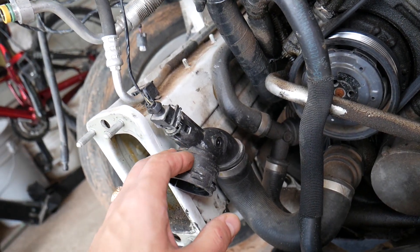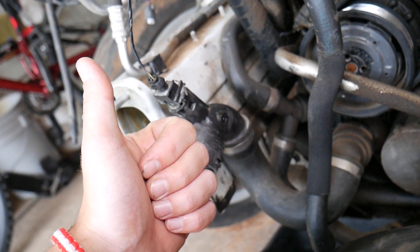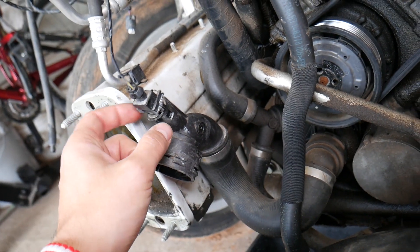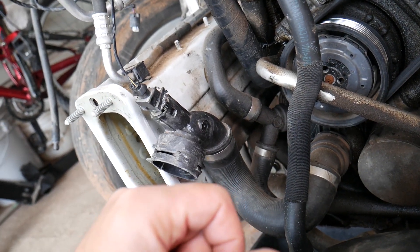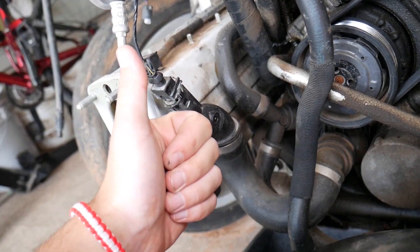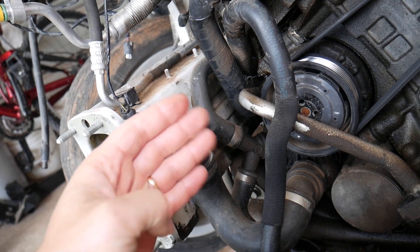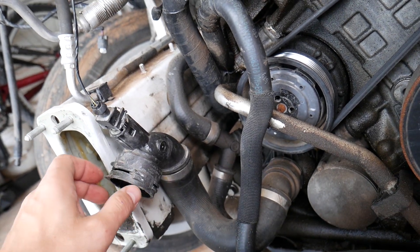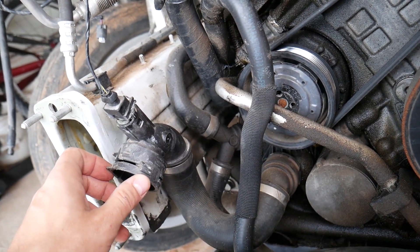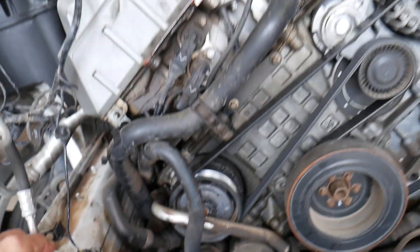The only thing you will need to do is drain your coolant. You need to drain your coolant and antifreeze because when you remove that sensor, coolant will come out. Also, you have to use special BMW coolant — we'll have the link in the description below — and you have to follow the specific BMW procedure to bleed the cooling system, otherwise you're going to overheat your engine because you'll have an air pocket stuck inside.